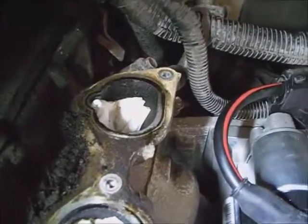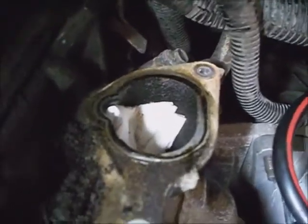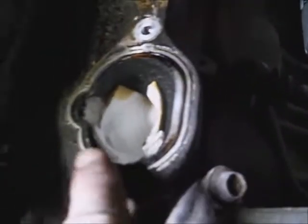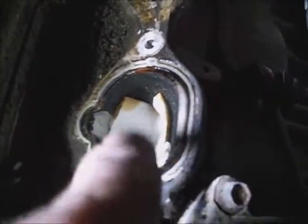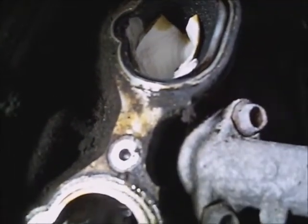Take a piece of wood or plastic and some brake cleaner and slowly clean off these intake ports. Free them from carbon and any residual residue. Pull the stuff away from the paper towel filled holes, and make sure no large debris has fallen down in there, and clean all those up.